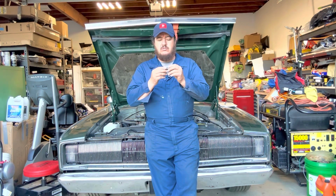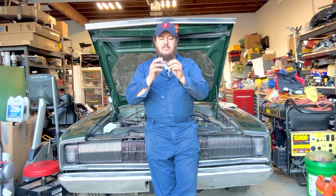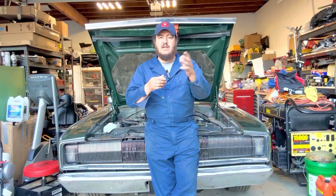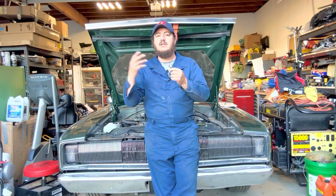Hopefully this video gives you an idea how to test, troubleshoot this at home. And they're pretty simple. All you need is just a light bulb, positive, negative, and just make sure that once you press, if the light bulb turns on or not. That's how you get an idea if the sensor is working, and it might be a different problem.